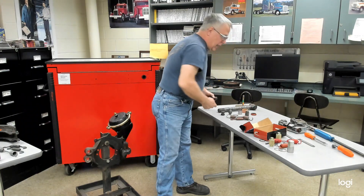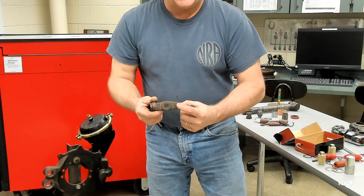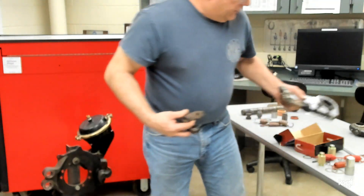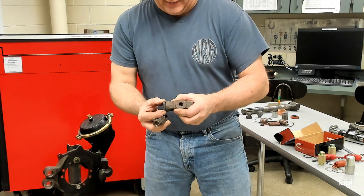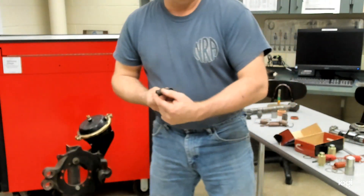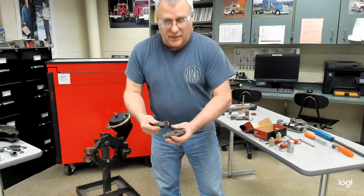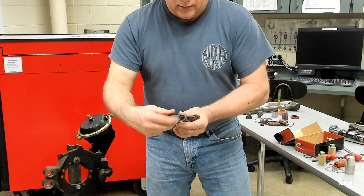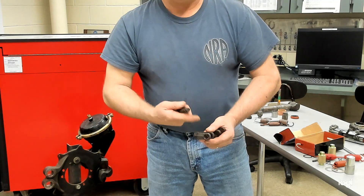Lastly, we have clevises and pins. This one is a double-pin clevis for an automatic slack adjuster like we saw on this Meritor. The old style had an adjuster built in; if it's even somewhat loose with any play, it will be replaced with the new style, which uses a separate jam nut. What you want to look for on these clevises is wear in the holes where the pins go — this one is slightly worn. With the pin in there, I can move it front to back a 16th of an inch; that's lost motion when we're braking.